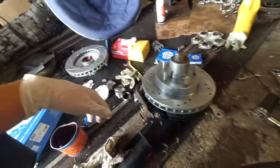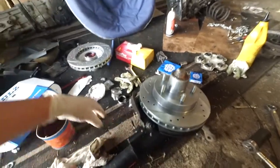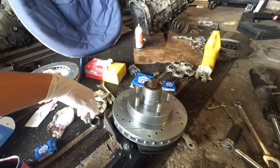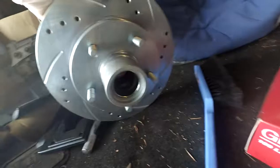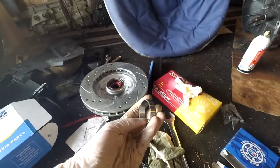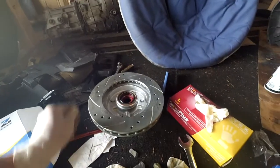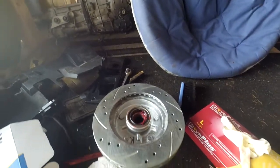This is my first time doing old American style wheel bearings, so we just went ahead and did one before we try and show you guys how to do it. I just popped this cap off and there's a castle nut with a cotter pin that was literally hand tight - we took it off with just a socket, no ratchet. Then take the caliper off. The rotor actually has the races included in it. There's an inner and an outer bearing - one's bigger, one's smaller, the outer one's smaller. Because I have new rotors and new bearings, I took the races off the new bearings since I don't need them, just plopped the new bearing down in there, hammered the seal in, and obviously completely packed it full of grease.